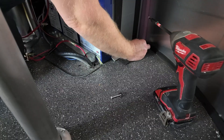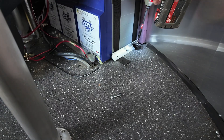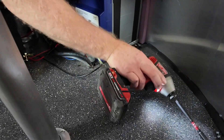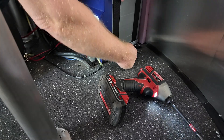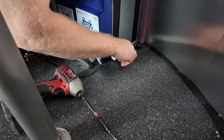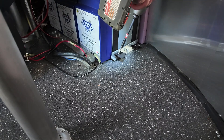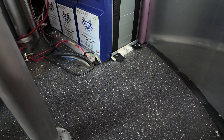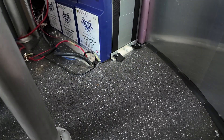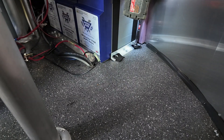I'm not going to show me putting the third one in, but I put the third one in. Stretched the straps over the top and now I'm snugging that aluminum L-stock so I can pull those straps tight. I've poked holes through, folded them over and poked holes through them. Got the screws through there — I'm using a screw with a washer on this side. Get that tight but not completely tight, then do the same thing on the other side. Fold it over, put the screw through both layers, push it through the hole in the aluminum into the webbing underneath, and tighten that down. Then I tighten that lag bolt in the middle to pull that bracket down snug against the floor. A final torque on these screws and batteries are secure.